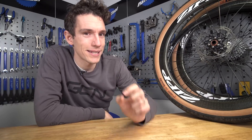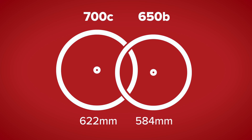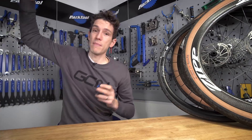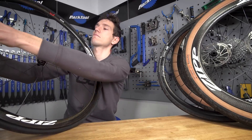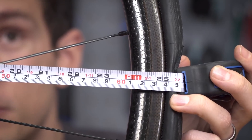We thought that we would take the opportunity over here on the tech channel to just delve into the subject a little bit more, to basically really geek out. First things first, the top line: a 650B wheel has a smaller diameter than a traditional 700C road wheel. It measures 584 millimetres across, whereas that 700C wheel measures 622 millimetres across. However, if you actually put a tape measure across your wheel, you will see that it doesn't measure 622 millimetres at all, because 622 refers to what's called the bead seat diameter — that's the innermost bit of the rim where your tyre sits.